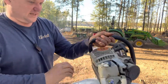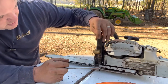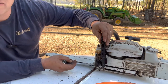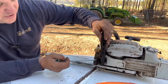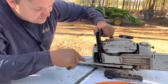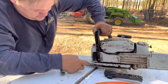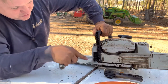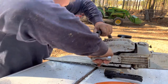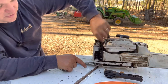The most difficult part that you'll find — you've got a spring right there. Here's the part; it sits in there just like this. You've got the two screws there that you pull out, and that first screw I showed you on the other side of the bar screws into this. Initially it'll look like you've got to take your oil tank off, but you do not. Once you undo the screw on the other side of the bar, you can pry that spring out. You can lift that spring up, pry it out, and that allows you to take the rest of the handle off once you have those two screws out.